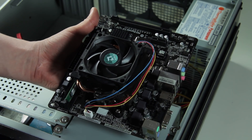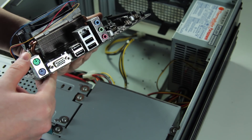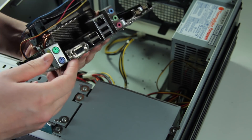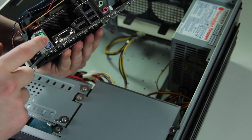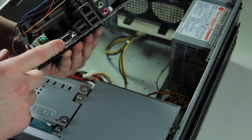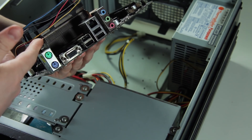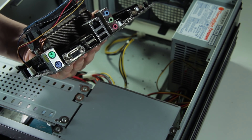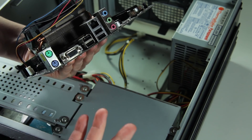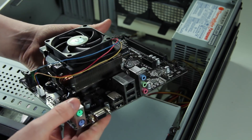That could probably be upgraded — I can get another 4GB stick for pretty cheap. Then it's got two PCIe slots, single gigabit ethernet, a couple USB ports but no USB 3.0 for some reason. It does have the PS2 connectors, which is nice because the KVM that I have is PS2. The visual output is VGA — so no HDMI or anything — and it's running an APU but also has PCIe 3.0. I just figured it would have HDMI and USB 3.0 on it, but it doesn't matter. I guess this is normally used in like a home entertainment system PC.